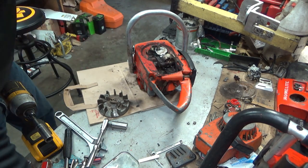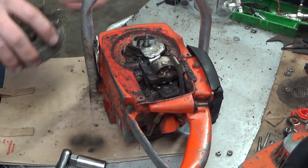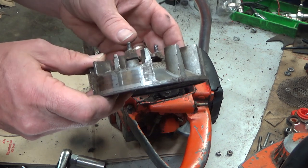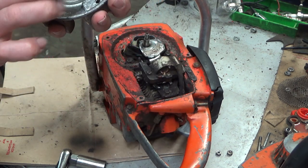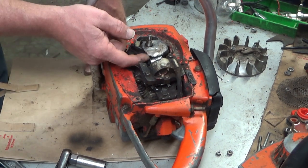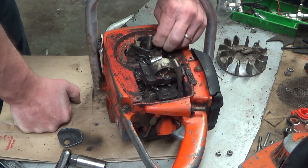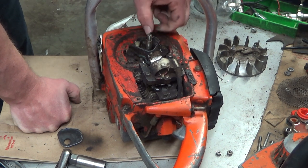How the rest of this happened beats the heck out of me. There's that piece of screen that was under the flywheel jamming things up. You can see the edges of the flywheel are pretty tore up here, but nothing broke any fins. There's nothing that will preclude this from running, and even this damage back here is just minor scuffing. Let's get to the real good stuff. That doesn't look right — the arm itself is all bent up and jammed up under the points, against the crankshaft and against the points. That may or may not be salvageable.